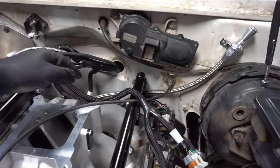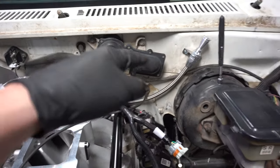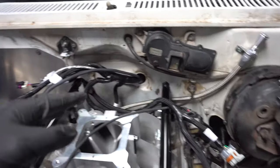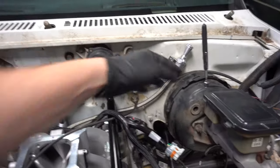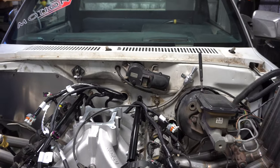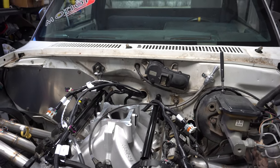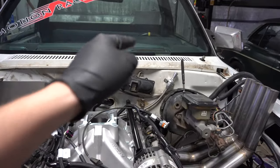After that I went ahead and put the trans dipstick in — just got a low-profile one. Somehow on the Mazda I ordered way too short a one, and now on this one I ordered too long — this one's 36 inch; I had to reach it clear to the other side. I probably only needed a 24-inch. But either way it'll work — with trannies you're usually swapping fluid out pretty often anyway, so you just fill it to the amount you know it should have and change it out. At least I have a way to fill up the tranny.